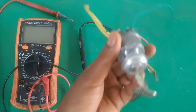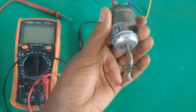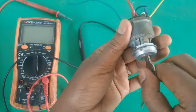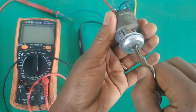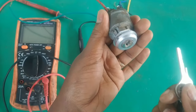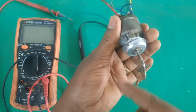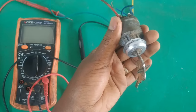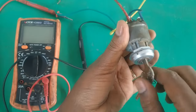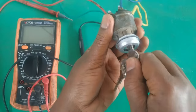There are two things that need to be considered. First is the key position. As you can see, there are multiple key positions. The position where the ignition key can be removed from the cylinder is usually the off position. From the off position, try twisting the ignition key counterclockwise — that position is usually the accessory position. So for this ignition key we have: accessory, off, on, and finally the start position, which is spring loaded.